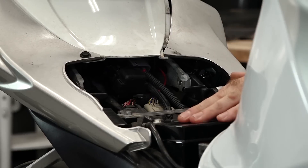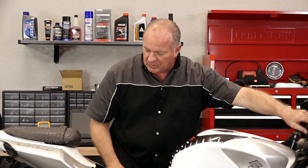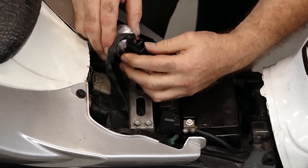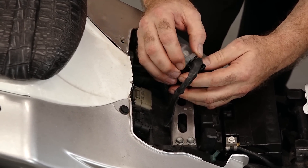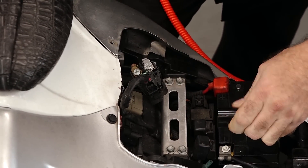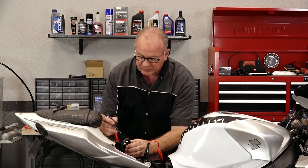Alright, beyond that, if we know we've got voltage here and we know the ground and the positive are tightened down tight and nothing's going on, the first place you want to look is this little starter solenoid that is hid right up under the tail section. In there you've got this plastic cover, so you want to lift that off and the first thing you want to check is the condition of that fuse. So grab your test light, put it on your negative. You've got it flipped on and nothing's going on — we need to zero in on this fuse.